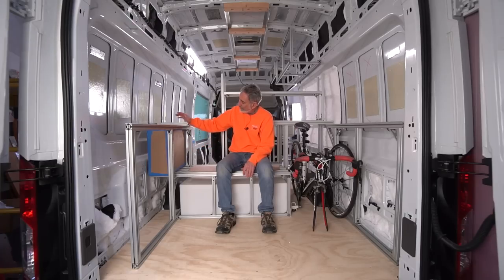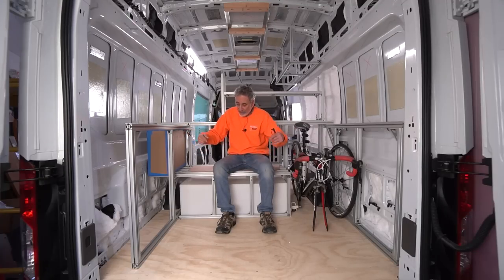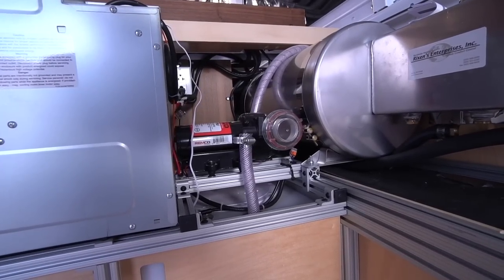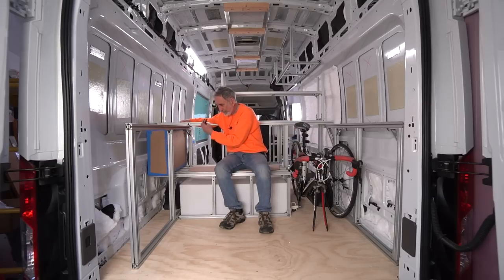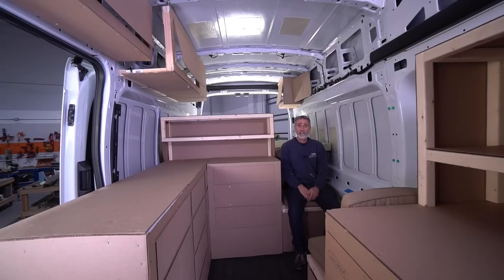So I'm back to using the Isotemp rectangular water heater in this van. I typically use the cylindrical barrel-looking one, which has been very efficient in terms of space utilization because it's only 12 inches tall and 12 inches wide. This rectangular one is 4.3 gallons. It does all the same things - heats water up to 160 degrees with the internal 750-watt electric element. When you run your glycol through it, you can get up to 180 degrees. These are used on boats all the time. It's tucked in there perfectly, and I'll be able to access the controls by just dropping down the dinette seat back.